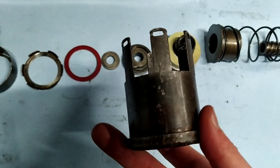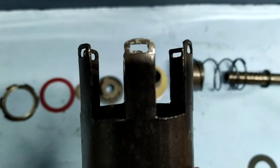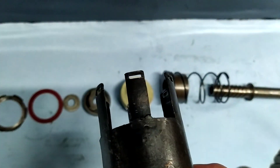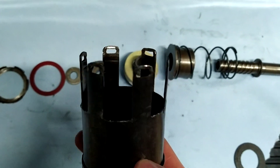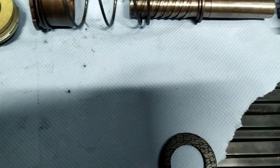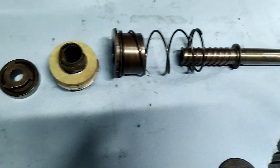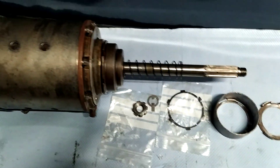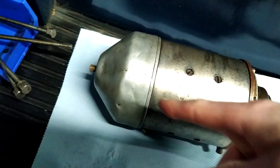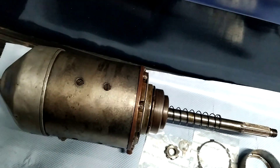On my cart I've had to replace the cassette cover. You can see here that the top joints have been modified, and actually one of them has been silver soldered back on because it's failed — so that's definitely worth replacing. To rebuild this unit, strip it down and first I'd recommend taking the end cover off the starter, cleaning the brushes, and scraping out the gaps in the commutator ring.